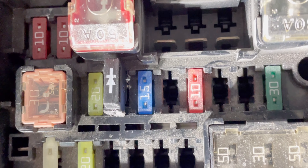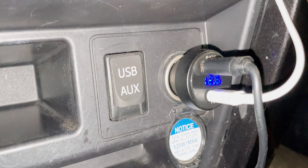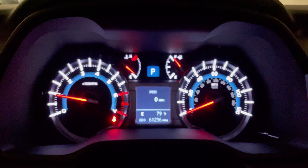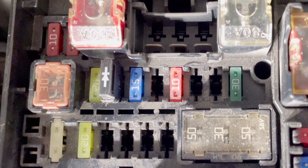You just put it back just like the fuse. Make sure the arrow points toward the driver's seat. In standby mode it's 12.7, but when the engine is on it goes to 14.5 — that's the perfect voltage, right in the 14.4 to 14.8 range. There's no engine light on. Checking again: it's 14.48, which is a perfect level. Make sure the arrow points to the driver's seat.